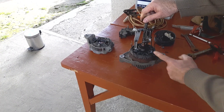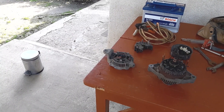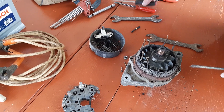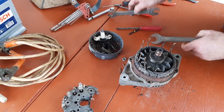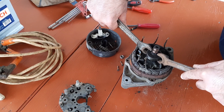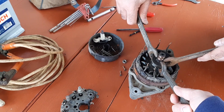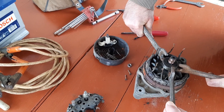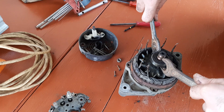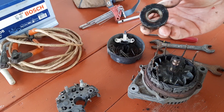So this time the puller really goes to the recycle bin. I don't like the idea of prying the bearing with screwdrivers, because screwdrivers can easily bend — they are short and do not provide a good lever to apply sufficient force. The best option to remove the bearing without any special tool is to pry it gently with two 17 or 19 mm wrenches. Nothing prevents you from doing it with three wrenches if you have them. Just be careful and do not damage the slip rings or the wire winding of the stator. I pried the bearing with two wrenches and here it is, and the slip rings are also without any damage.